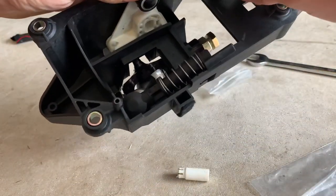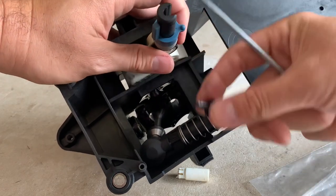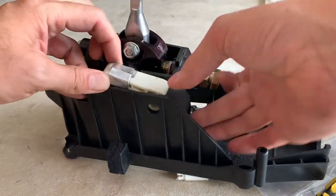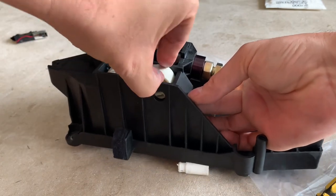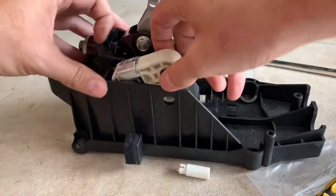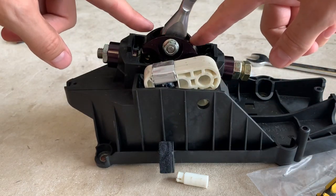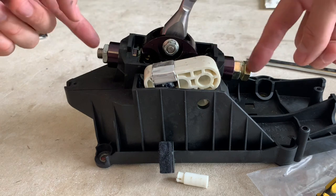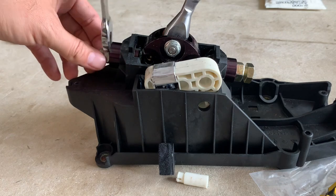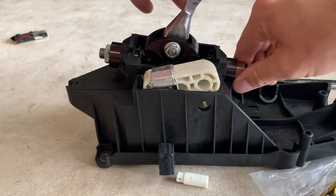The connection on this side is just a press pin - the new one is a bolt fitting, so that's just a little plastic clip to remove. Now we should be able to get that out. I think we've got to take out the whole short shift mechanism to refit the new one. Yes we do, which is good because I wanted to move this shifter mechanism back a bit - it's a little bit far forward, and you do that with these bolts here.